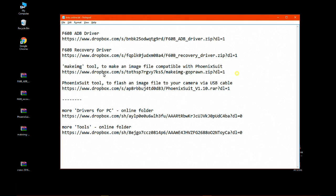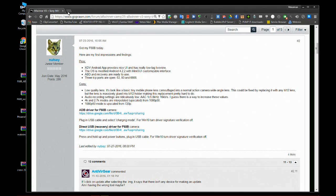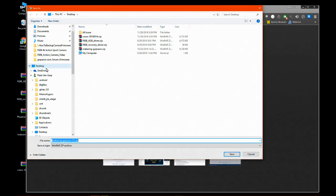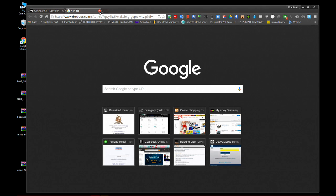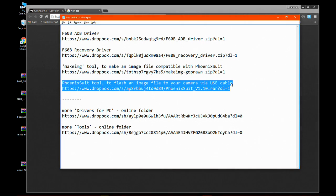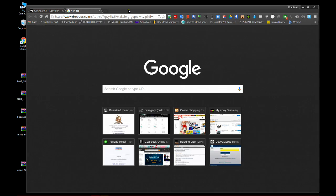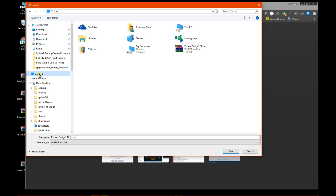And now we need to download some more tools. Makeimg tool. Use this link, and this link again is in the description below. Copy and paste the link to the browser so you can download it and save it to the desktop. Go back to the notes and get also the Phoenixsuit tool. Copy and paste the link, put it in the browser and download this and save this to your desktop also.